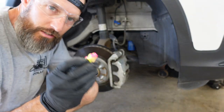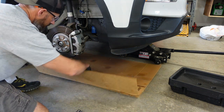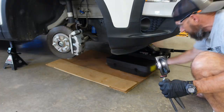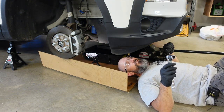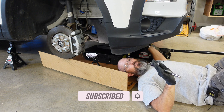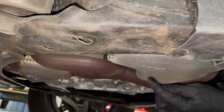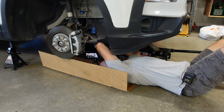Let me get these out of my ear so I quit yelling at you. This is where I'm gonna put my cardboard down under my car — it'll help catch any mess. I really don't want to get oil all over the floor of my garage. This right here is the drain plug — like I said, 17 millimeter. It says right here engine oil, so you really can't screw it up. Let me move this out of the way so I can loosen this.